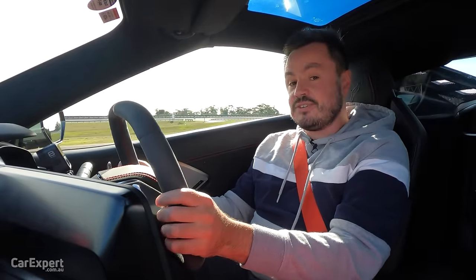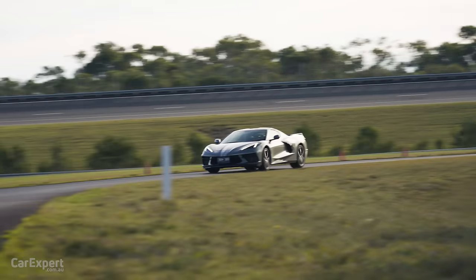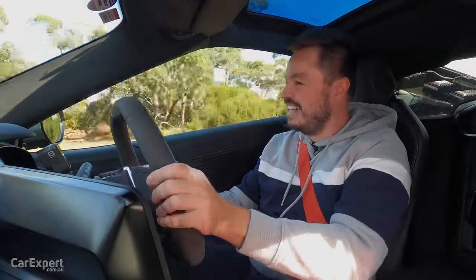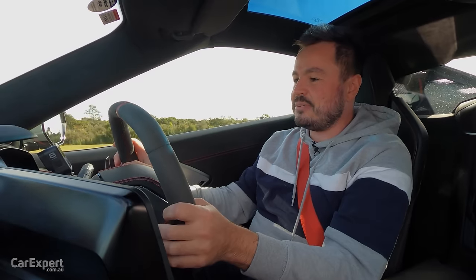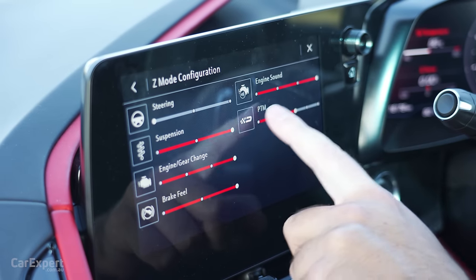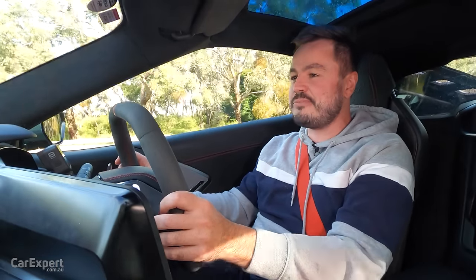Beneath the skin you've got an electronically controlled limited slip differential at the rear. You've also had a rear axle ratio change — from 4.89 to a little over five — meaning you can accelerate a little quicker. It does sacrifice top speed ever so slightly, but you get even more acceleration out of it. In Z mode you can go through and tailor all of your stability controls. If you're a little more confident, you can start disabling some of that nannying, but it still has your back — or you can go fully off if you choose.